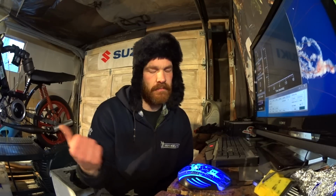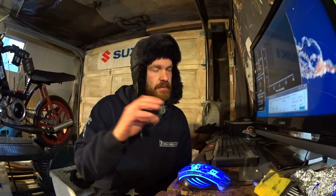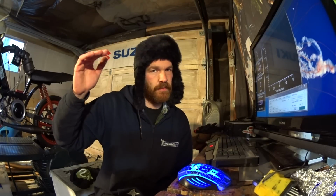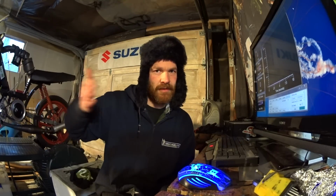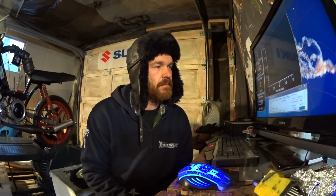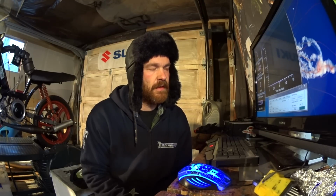I've checked around the net and talked to people, and with the variator it's very typical to have higher transmission losses than on gear bikes, often in the range of 30% or around there. It really sucks power, the belt drive, and the misalignment with this single variated belt drive. So calculating with 25% loss, I'm actually up around 20 horsepower.